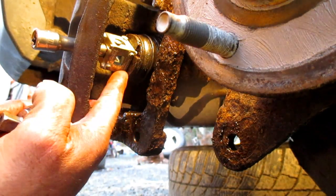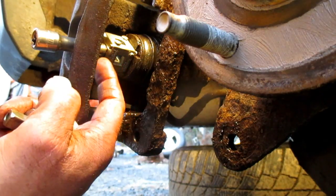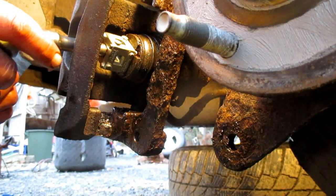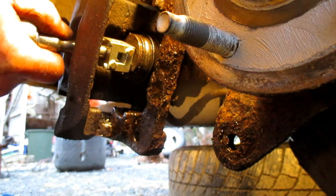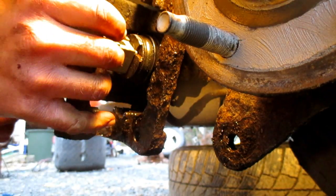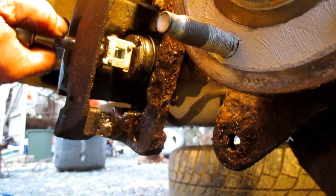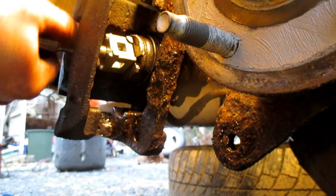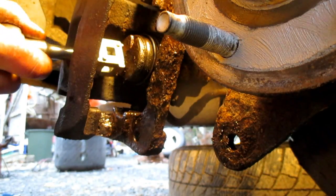I've placed the retraction tool onto the plunger of the caliper. You can see the extension coming through here. I'll put my socket on and make sure that it's set for righty-tighty. Put that in there — oops, kind of slipped out. This particular plunger is kind of gummed up with a whole bunch of refuse, but you get the idea. Just turn that and hopefully you can see that the plunger is retracting into the caliper.